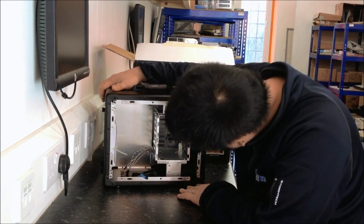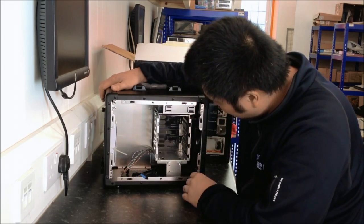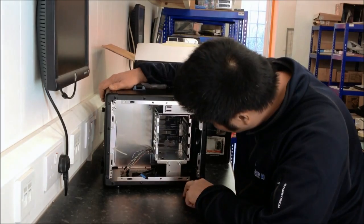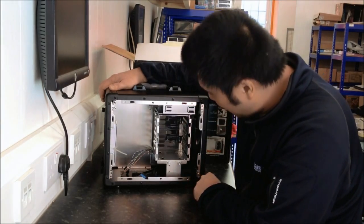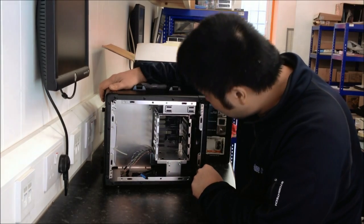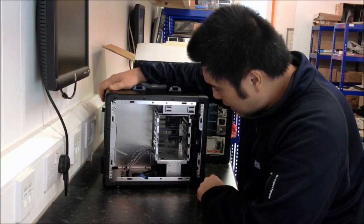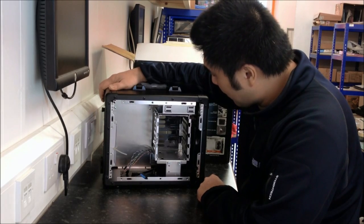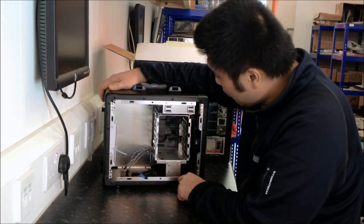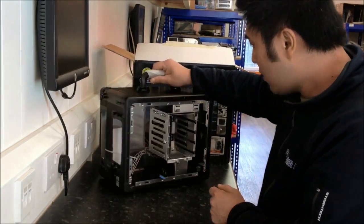I'm not sure whether that intrudes into the mounting of the caddy itself, so would you necessarily block another hard drive if you put an SSD here? But I'm guessing with so many drive bays available, you surely would find a way to fit the drives that you want to buy without a problem at all. And I'm also certain that with the accessories list, there's going to be a part that lets you mount a 2.5-inch drive into one of these drive bays using some sort of adapter, but I should check the accessories list for that. What else is in the case?